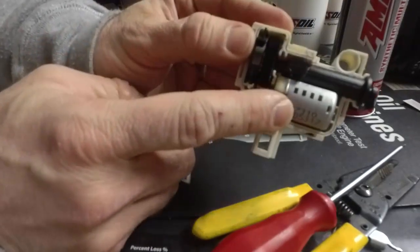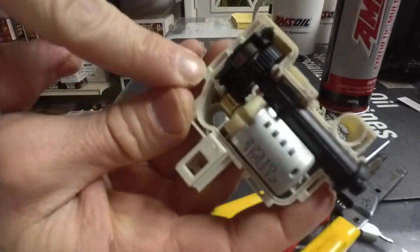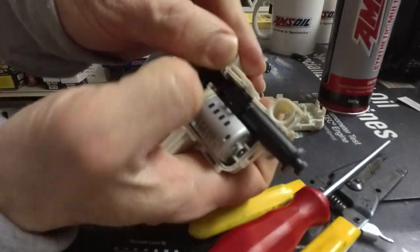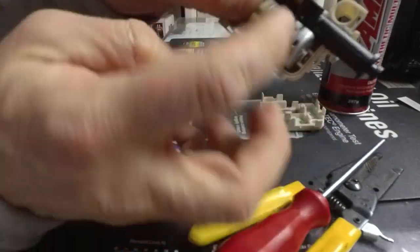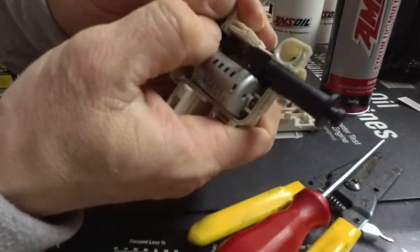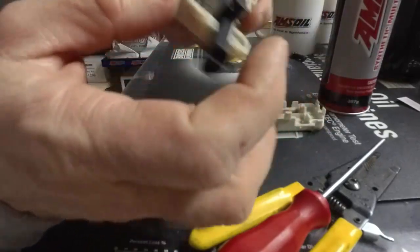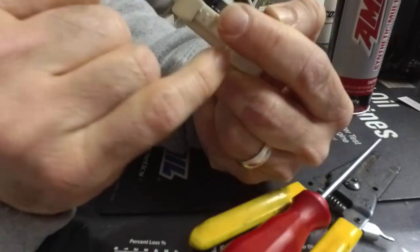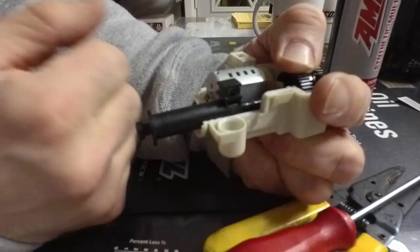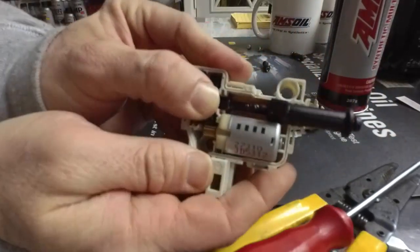Basically, you got this very strong 12 volt torquey motor, electric motor in here, and you can see the little gears that it moves, and when you hit the button, in an instant it just winds up this gear, and the drive is on a worm gear, so it pushes that out. I've seen a lot of other things like this. So it's extended all the way, and that's where it was stuck. That little capstan was wedged in here somehow. When I took the lid off, it didn't instantly pop back until I moved this thing around. It was stuck. So anyway, when you let go, watch this.